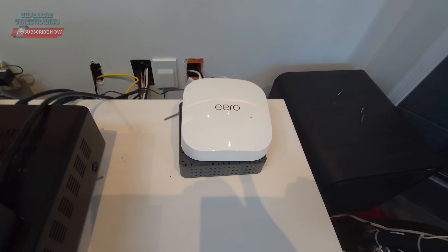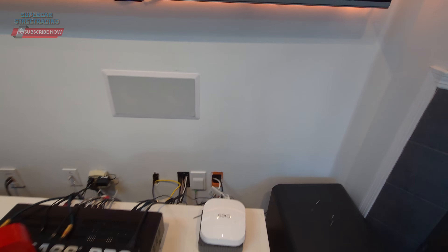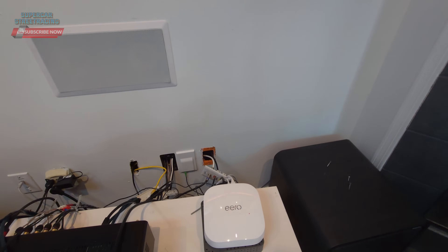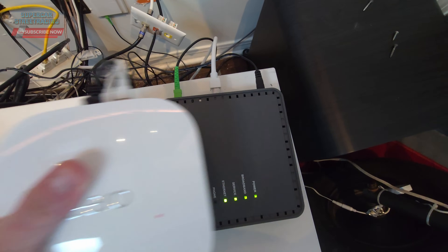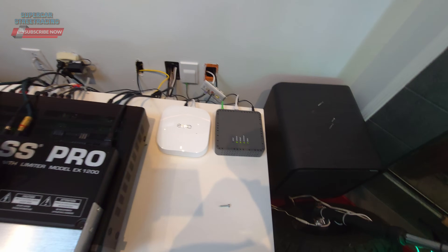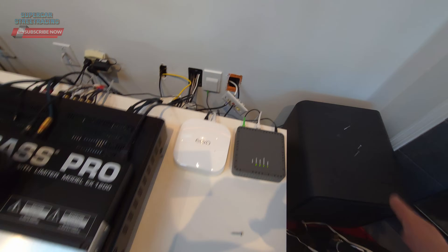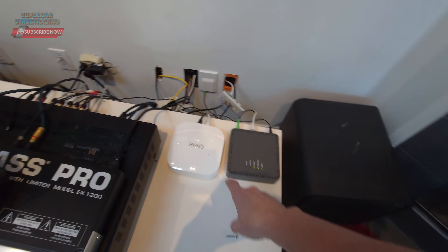My Eero device is sitting on top. This is five gig fiber, so my maximum speed is going to be five gigs. Coming in from the WAN side — IQ Fiber — that green connector right there is five gigs going into the modem. The modem demodulates the signal into Ethernet. It comes out of the Ethernet port, and on the LAN side of the Eero, which is the black cable, the maximum speed is one gig. You're never going to get more than a gig on the WAN side of this network because of the limitations of this Eero.